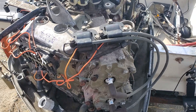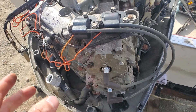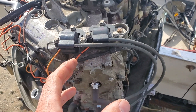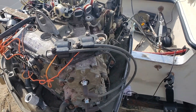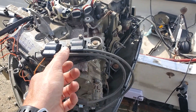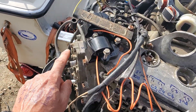A lot of you guys don't have DVA adapters. The best way to look for intermittent spark is to hook up a timing light if you can get your motor to idle and just point the light at your eye. If you're epileptic, don't try this. But look for a steady flash at idle. If you see a flash that's haphazard or coming in and out — I say at idle because obviously when you rev up it's going to flash a lot quicker — just look for a steady, perfectly flashing light. Keep moving the connector to all these leads, and if you see one that's kind of dropping now and then, you've got to hone in on that cylinder.